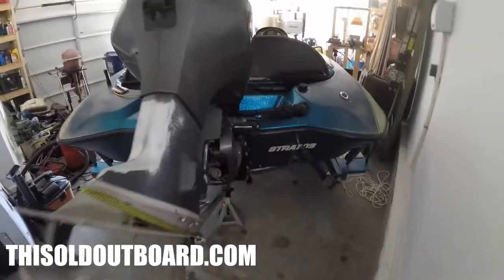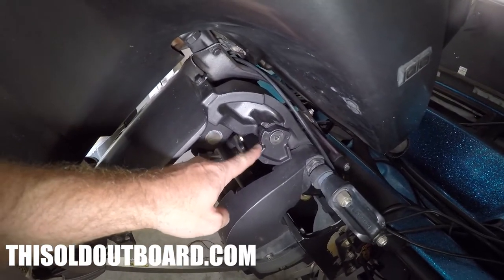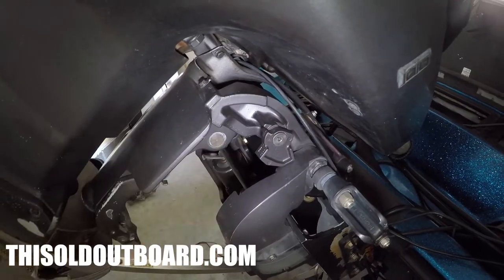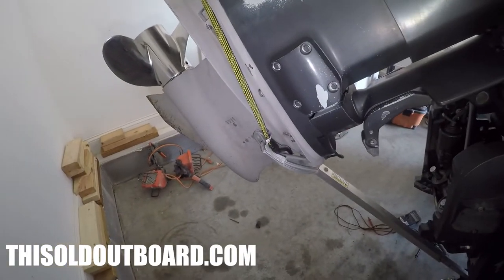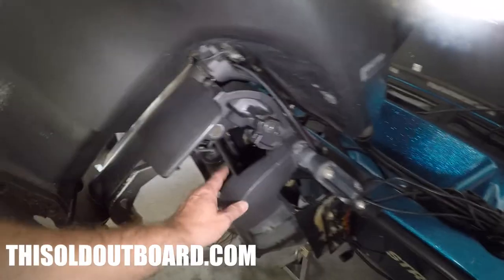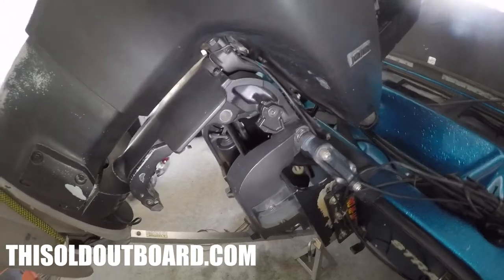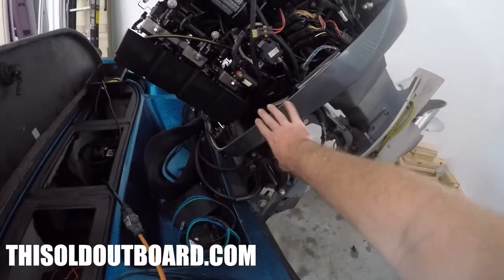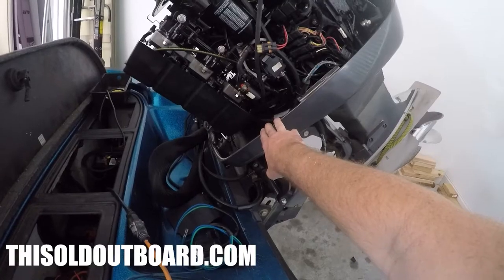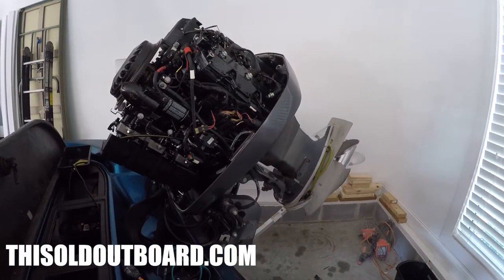You'll want to pitch the motor all the way up, then at a minimum flip down your manual catch. Try to support it somewhere as a redundant safety mechanism — if this thing were to fall and you have your hands in here, it's going to be a bad day. You'll crush your hands; the motor's pretty heavy, so just beware of that. Next, we're going to remove this half of the lower cowl. I couldn't really find any YouTube videos that demonstrate how to do that, so I'm going to make one. The service manual doesn't really detail it either, so we're going to figure it out.